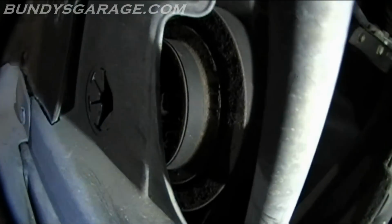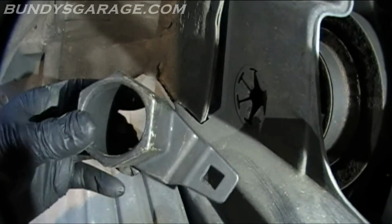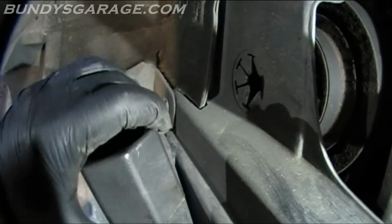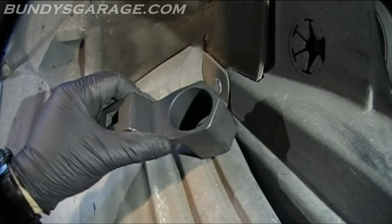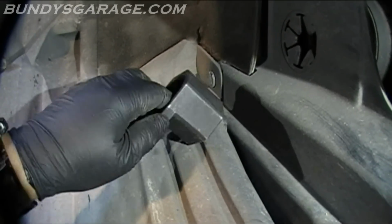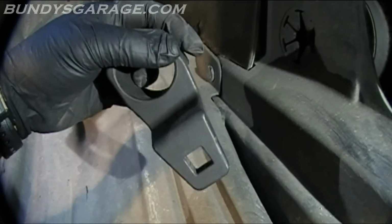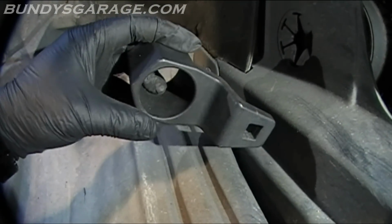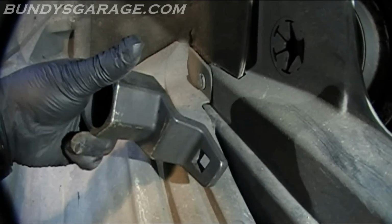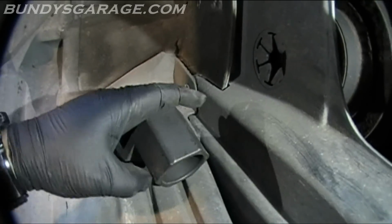And what that is for is you have a 50mm tool like this one right here that goes in and holds the crankshaft in place while you turn the crankshaft pulley bolt. So you can pick this up at, I've seen them at Napa, I've seen them at O'Reilly's. I think you can get them from AutoZone too, and I think you can rent them. I actually picked this up from Amazon. I'll put the link in the description.